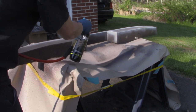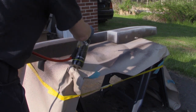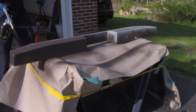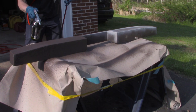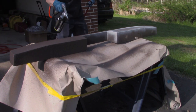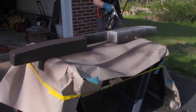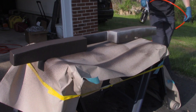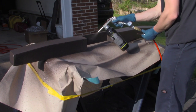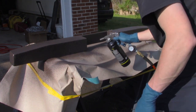The back side of the bumper set up in about 45 minutes, which is pretty fast for paint. I attribute a lot of that to being in direct sun — it was close to 75 degrees, low humidity, your ideal painting conditions. The Raptor paint is very forgiving; to get a run like you would with a two-stage auto body paint, you'd have to hold the gun very close for a very long time. From start to finish it was about an hour and a half between the two coats on the back and two coats on the front.